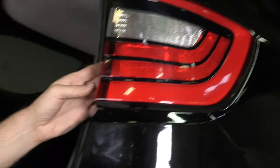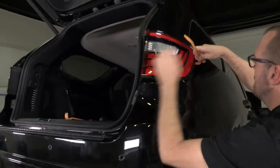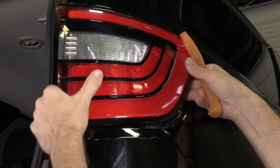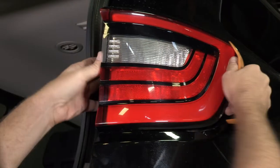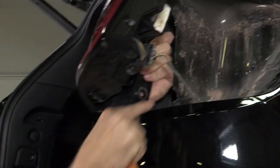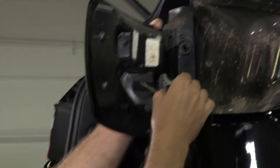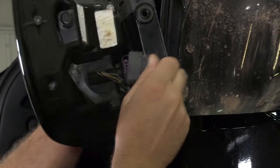From there, we're going to pry just behind the rear edge of our tail light, wanting to bring it straight back. Because we have, as you can now see, two ball-end clips here and another double retainer clip here at the bottom, the tail light just wants to slide straight back and out. We now see our factory harness connector — this multiple-pin connector — and we just depress and push in on that fastener there and remove the clip.